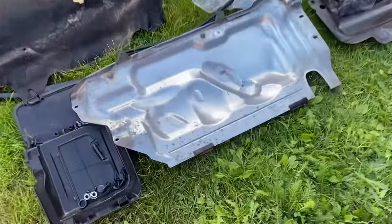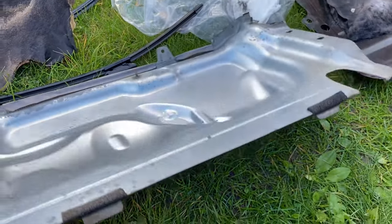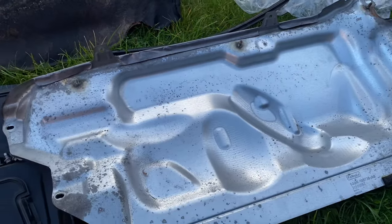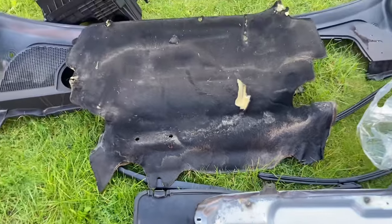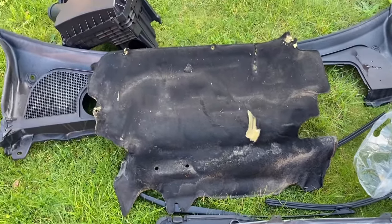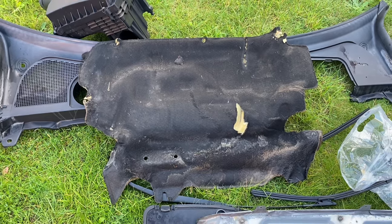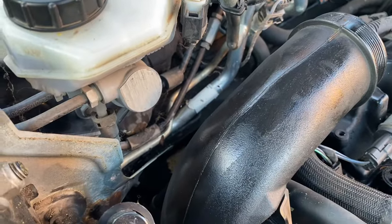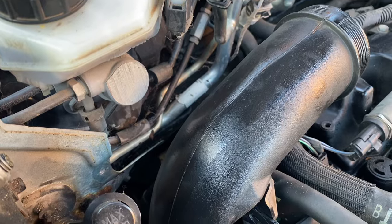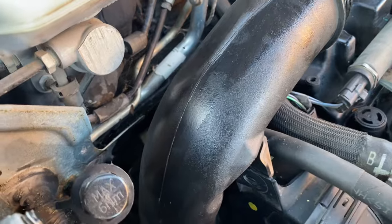In terms of actually getting the panel out, on the right hand side (battery side) as you look in, the panel hooks over those two pipes and it also hooks in behind the vacuum pipe. You need to pull the panel forward slightly on the left hand side beside the brake servo, then angle it upwards. I think it could be fun trying to get it back in again because looking at the bottom of the panel it seems to hook over at the bottom, and the insulation is a bit worse for wear.